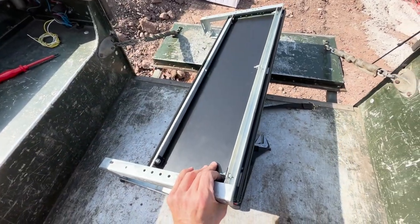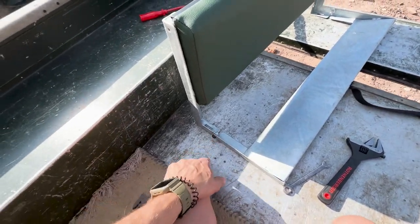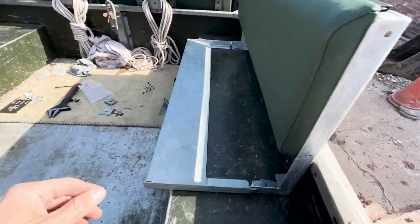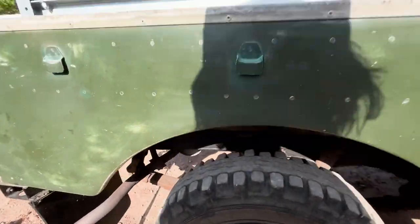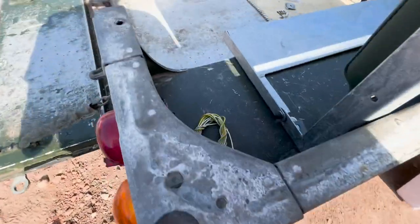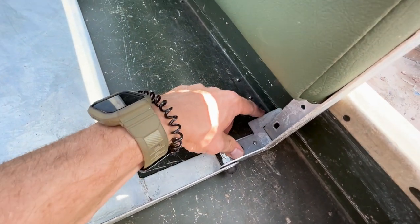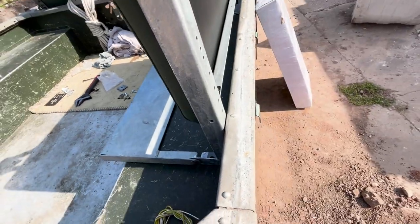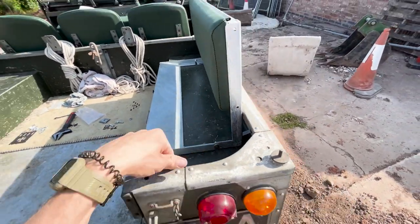The seat back is now completely bolted on with those five bolts. We're now going to find a place to mount it and I'll show you how I locate the holes — similar to what I did on my Defender. I'll use these spreader plates: the bottom spreader plate goes underneath where the bolts come out from, and then the top one acts as a clamp to support and keep things down. It's really about positioning — how far forward do you want to sit.